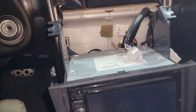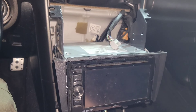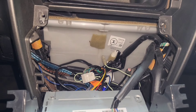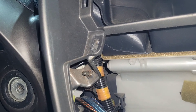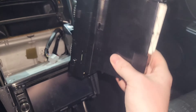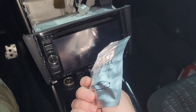Now that I'm into the dash here, I hate that they replaced the normal metal bracket with plastic ones — the metal one would work just fine for all of this. She's decently clean. However, the ground is going into the factory harness and that's not always optimal. So I'm going to move the ground up to here where this bolt is and manually pop it there. Then in the meantime, I'm going to work on this thing. I've got to take those little screws out and then just replace the bulbs in there with the kit I got here.